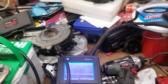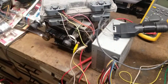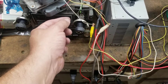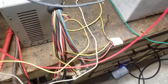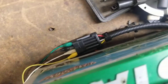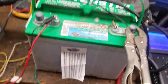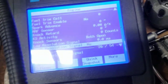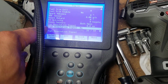I'm messing around with some OptiSparks here trying to figure out a bench system, so I threw together a little rig — this is my benchtop programming harness. I added two wires to the high and low resolution signal, which runs over to that connector there that plugs into the OptiSpark. The other two wires simply provide power, all off of this car battery, and then I plug into the diagnostic port. I have my Tech 2 on data mode where I can watch the low res and high res signal.